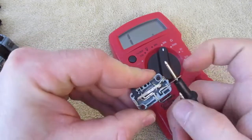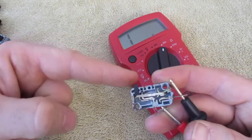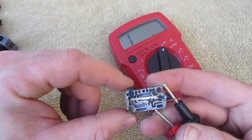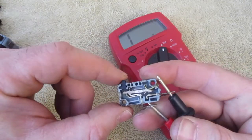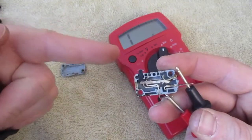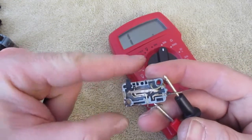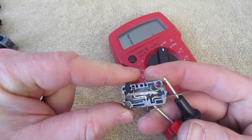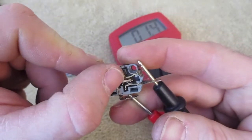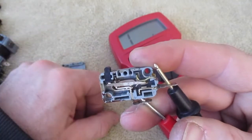So we're getting no reading. Then what happens is when that lever gets shut — your microwave door, or these can also be in cars or dishwashers — this is how the switches work to operate your door. When the microwave door closes, it hits a little piece of plastic which comes down through a little lever system and pushes this down. When I push this down, that connection is made, so now it's considered closed. This one is considered an open micro switch.